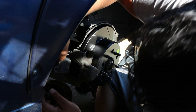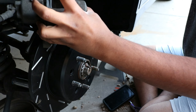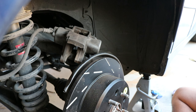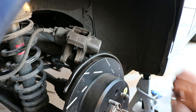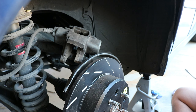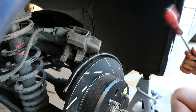Let's slide this one right in here, just like so. On the other side the brake pads just slid right in nice and easy. This side I think is going to need a little cleaning to get the pads to go in — just to decrustify this general area. On the other side the brake pads went in fine, they were nice and smooth. I didn't have to put any force. I've already cleaned the interior of the caliper to make sure there's no debris, and the old pads go in nice and smooth. But when I try to put on these new pads on this side, it gets stuck right there and I have to whack them in a bit.